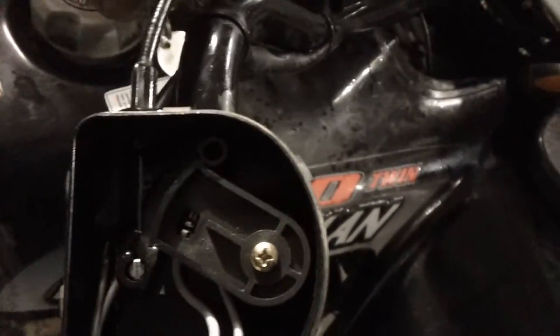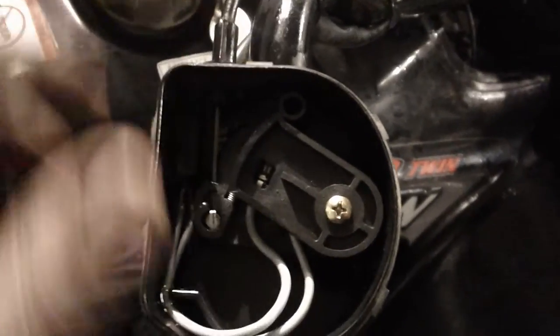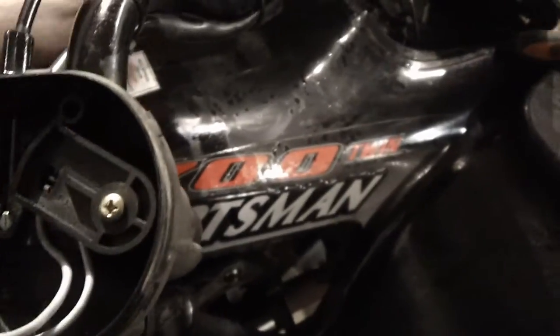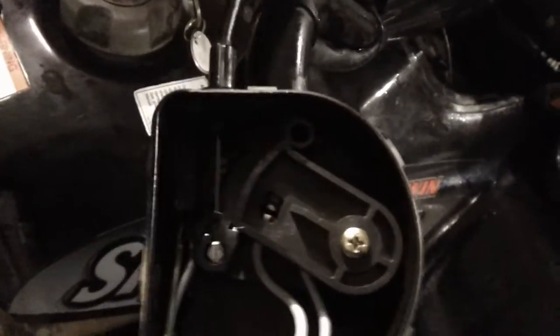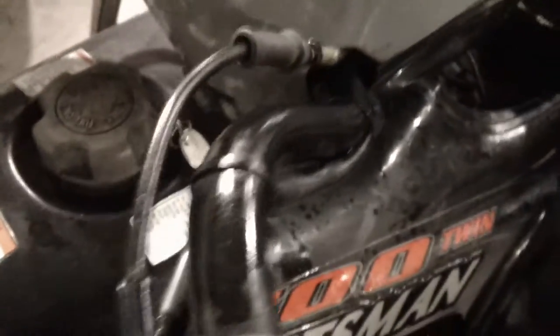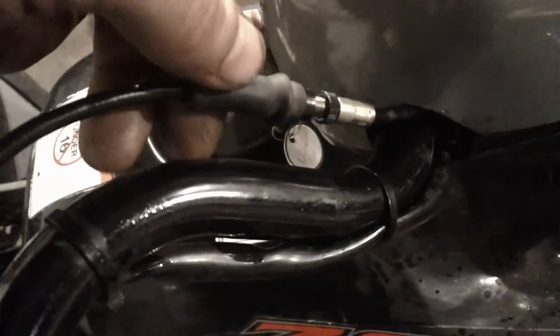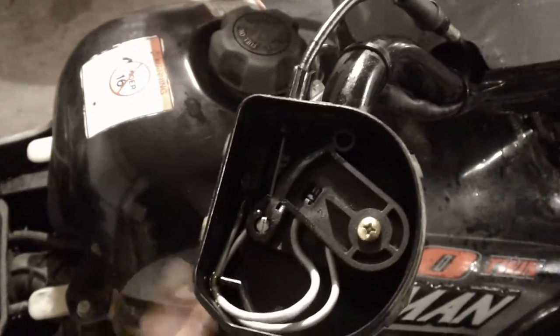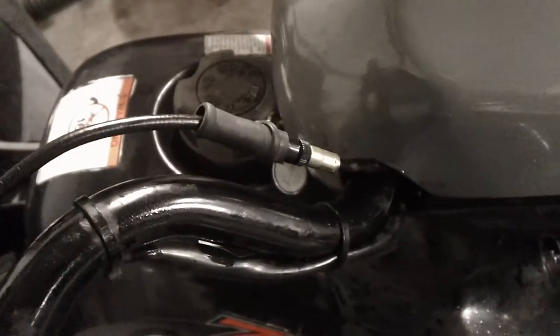To solve that, you adjust it here — you just take the play out of the cable, then go a little more so that the switches are open. You need a little bit of a gap. It's still moving but not going together. If I turn it in too far, your motor stops. The cable's stretched; I have a brand new quad and it kills. The thing wouldn't idle at all, and that's a pain — you can't let it warm up, can't let it idle. You adjust this out until you get a little bit of a gap.